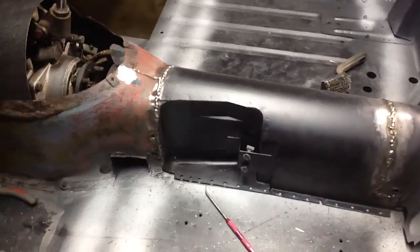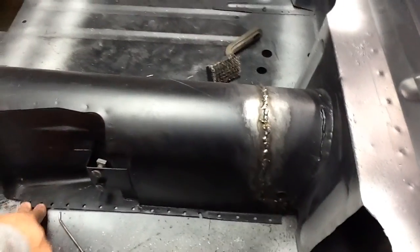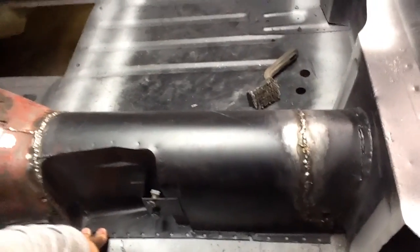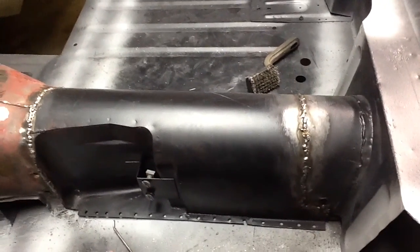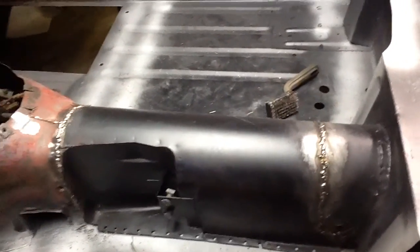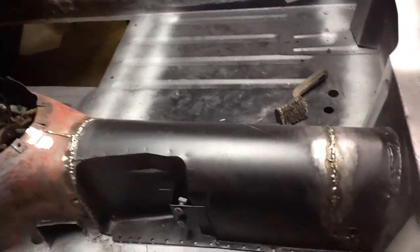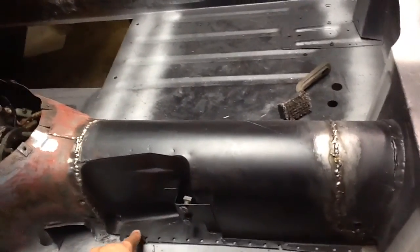All the lower side too — I rebuilt all of this lower area. It's about 3/16ths too high here, but the floor, when they stamp it, it gets warped. So this is visibly sitting lower. What I'll do is put the jack up under here and lift that up before I weld these down.